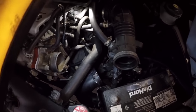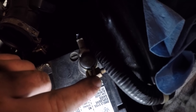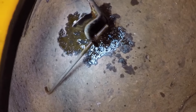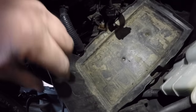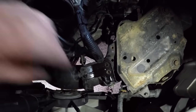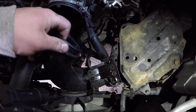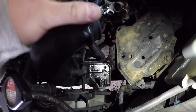I decided I'm taking the whole battery out - there's just way too much in the way. The terminal bolts are 10 millimeter, one on the negative and one on the positive. Take those off - but take this battery support off first, both 10 millimeters too, and the battery should just come right out. Now that the battery's out we can take this box out from underneath. We got the two 10 mils off the bracket. To get the intake hose off, twist it towards you, wiggle it off and pull it right up towards you just like that.